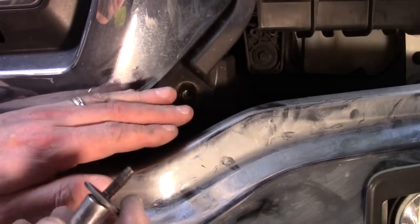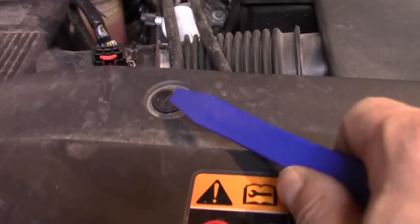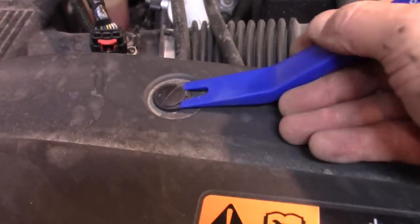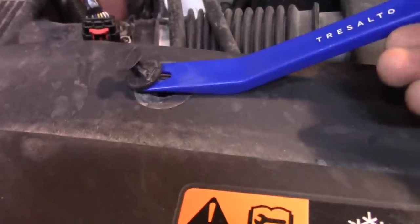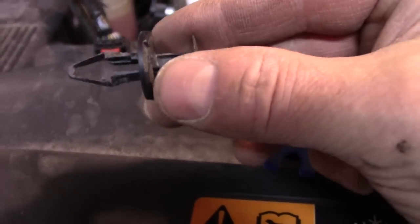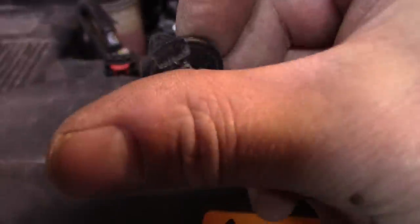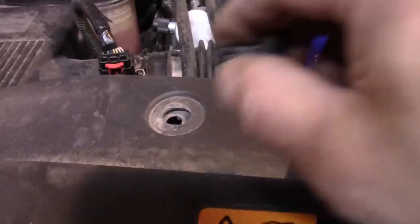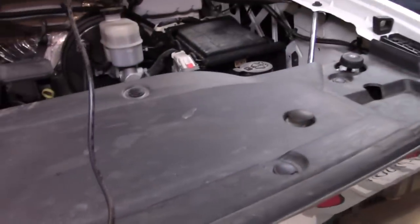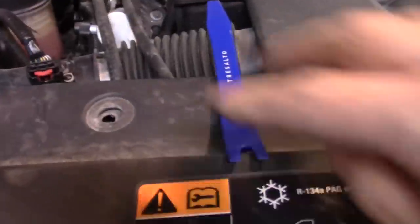That's the last one on the bottom. Let's shift gears and move to the top. We need to remove this plastic shroud here, and to do that we need to remove these trim clips. Basically you need to pop up this top piece first, and then the bottom comes out as well. Don't just pry on the bottom piece — the top piece needs to come out first because that allows this bottom piece to compress. I believe there are 12 here, all across the top of the shroud, front and back. Let me pop these out, and then we'll remove the top grill bolts.